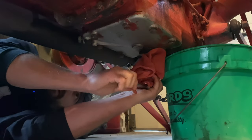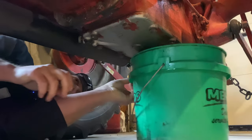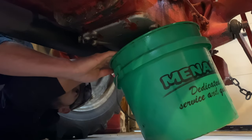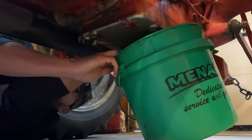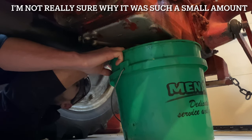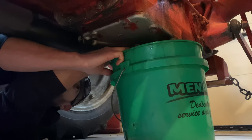While we let that drain out a little bit, this rear one I think is an inch and a sixteenth, which I don't have that socket for, so I'm going with an inch and an eighth that I have. Put a rag in just to get this thing loosened up. Like I said, there should be five gallons in here, so with my little three-gallon bucket we might have to stop, pour it out into a bigger bucket, and come back and get the rest.